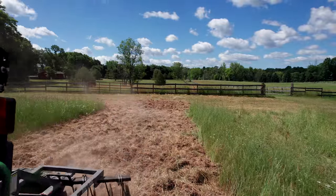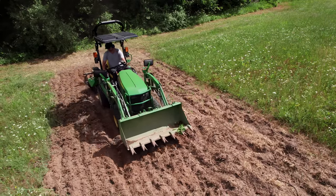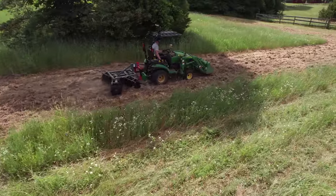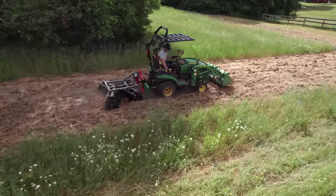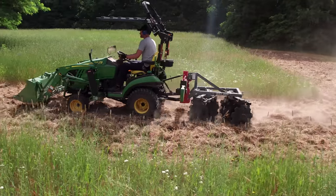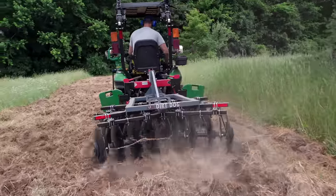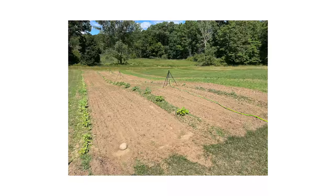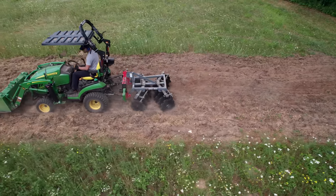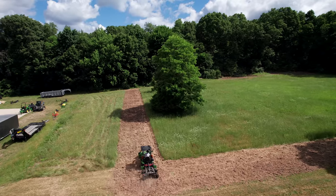It's a cooler day and it's morning time. I had the throttle set just partway up — number one, that was to help control speed. I wanted to go fairly slow; that ground was super uneven so you couldn't go too fast. I throttled up a bit more on subsequent passes as it gets smoothed out. We made it through the whole process and the needle was just still in the green, almost hitting the red — we didn't overheat at all today. But just the other day I was using this disc as more of a cultivator in our garden with everything at least aggressive as possible on the disc angles, just easy passes up and down — probably 10 minutes of work — and it was already overheating.